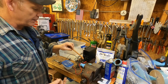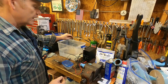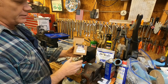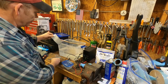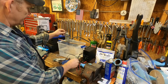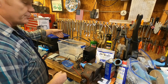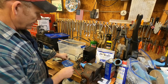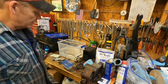I've got some welding wire and a piece of copper tubing left over from when I had my household air conditioner replaced. You hang the part using the welding wire down in the solution, and you get yourself some roofing zinc - a big roll, it's cheap, get it on Amazon. Cut a couple of strips, hang them down in the solution with the positive lead on one of them, then your negative lead from your power supply goes to the copper tube where your parts are dangling. Put a second strip on the other side and connect those two strips with a jumper.